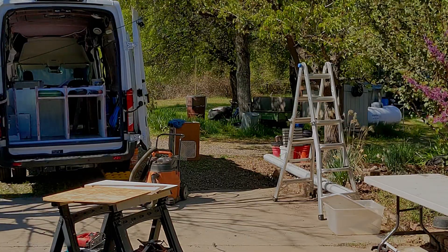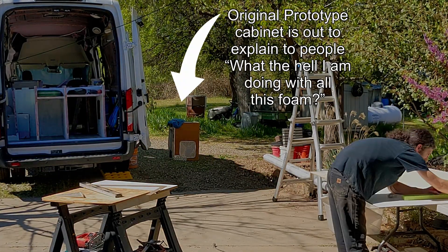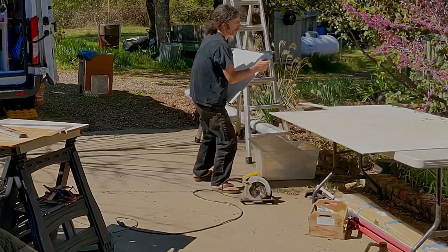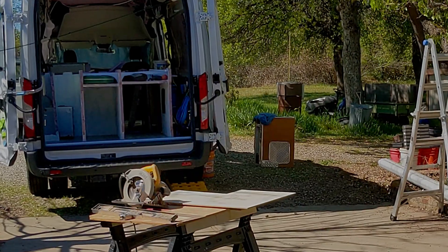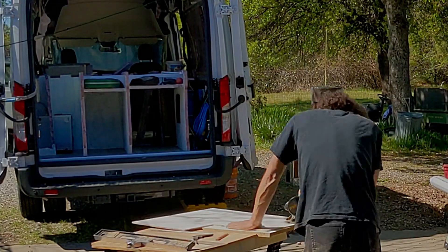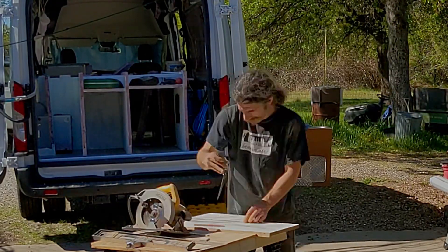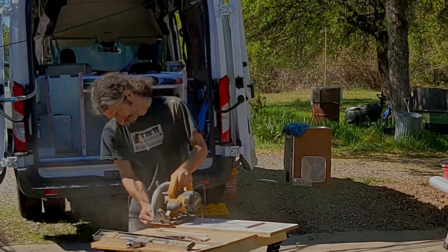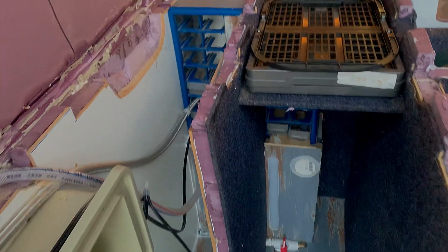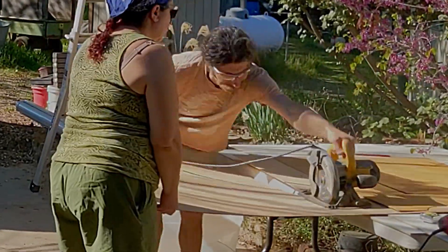Let's get into some of these and see how I did it with the materials I used. The first structural skin is this quarter inch melamine — the plastic cover I used in my water box area where my water tank and plumbing fixtures are. Just cutting this out to size and using Gorilla Glue HD to glue it down, clamping those in place as I go. Once those are all in there, it looks like this white area on the left. I could have also used fiberglass reinforced plastic panels in that area.